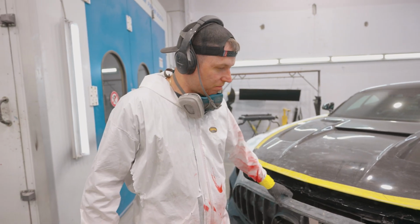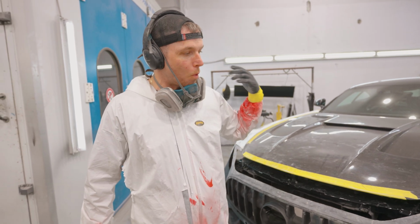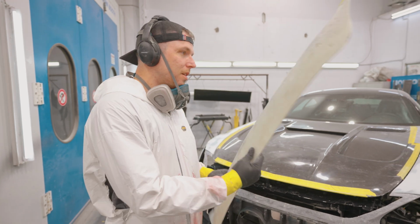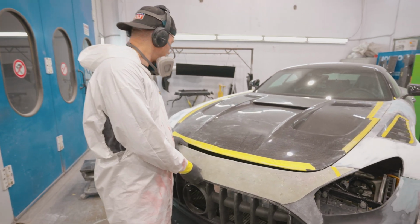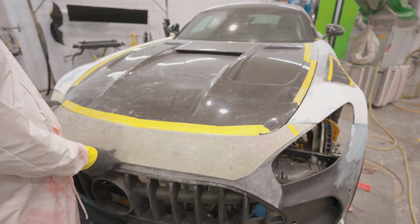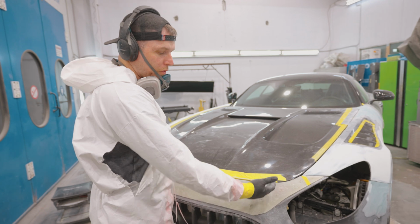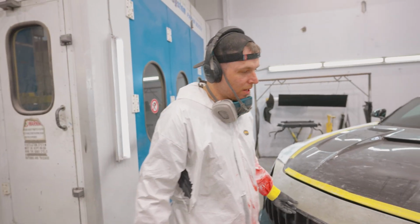I don't know, it's probably an issue with when the bumper was removed from the mold originally at whoever made the kit. But that's how we fix these issues properly with fiberglass. So now we'll graft the 2 pieces together, take it off, reinforce the backside, make new brackets to mount to the rad support, because this piece has, these are pretty janky.